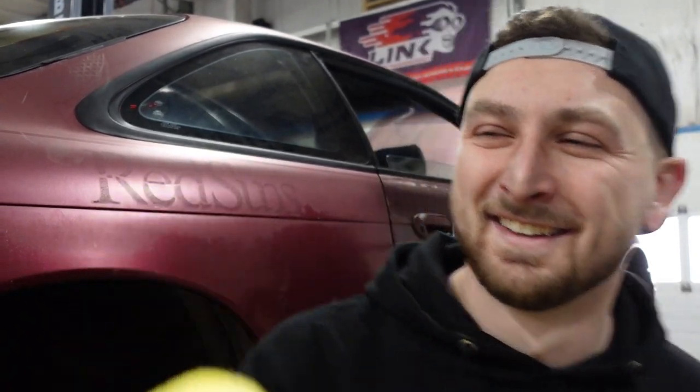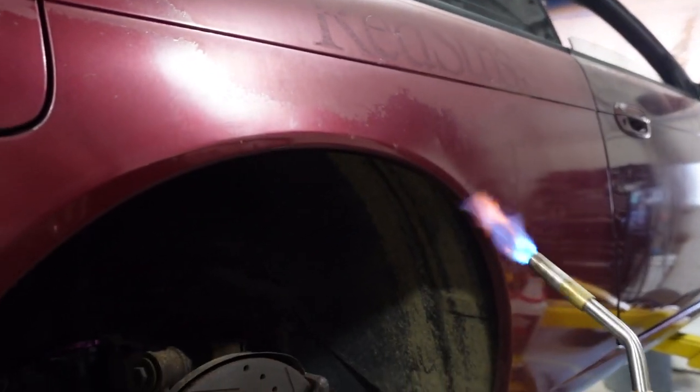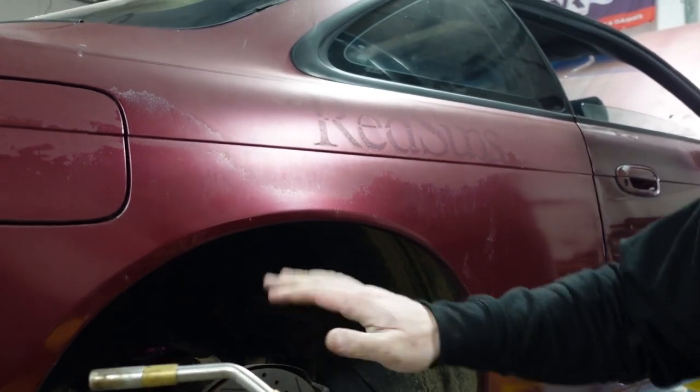All right. So I'm gonna do the good old fashioned hammer technique. You gotta be careful when you do this, all right? So if you have good paint, you gotta heat it up. You gotta make it more malleable because if you start bending this metal, it's gonna crack right here and you're gonna have a really bad time. Are you considering this good paint? No. But I'm gonna do it anyways because I don't want cracking. Basically, you just wanna heat the paint up enough that it's not burning to the touch, but it's on the hotter side of warm. So like room temperature? No, it's uncomfortable to touch, but it's not burning. Like when you drink tea, the best temp is where it almost hurts, but it doesn't. Oh, this is like hot chocolate for me then. Yeah, there you go. Okay.